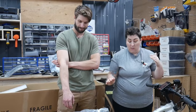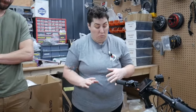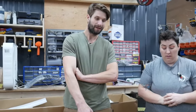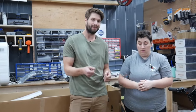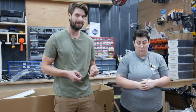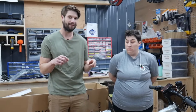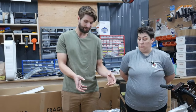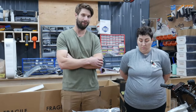This has our ultra motor — what kind of advantage does that kind of motor offer on this type of bike? This bike is really well set up for the ultra motor. When you're riding winding roads or rough terrain you'll really enjoy that torque sensor because it adjusts a lot faster than a cadence sensor would. With a cadence sensor you'd end up hitting your brakes a lot while changing gears; with the ultra motor and torque sensor you're right in it all the time — much more intuitive while you ride.